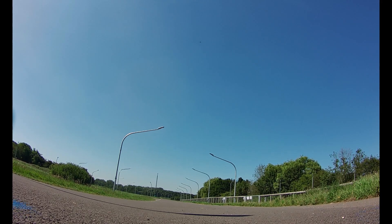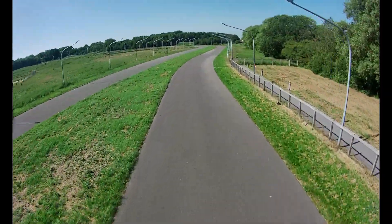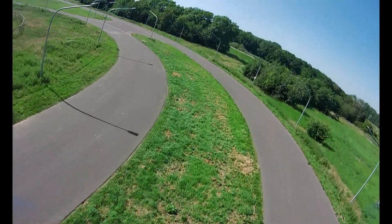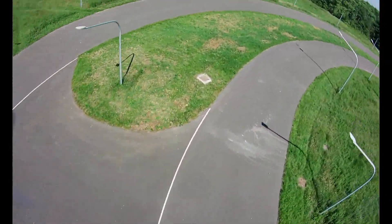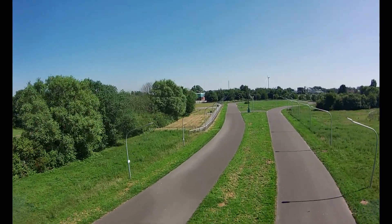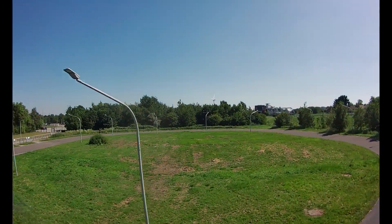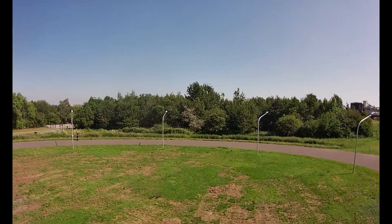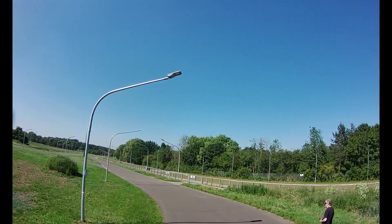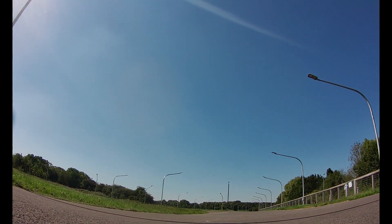For testing, I took the folding props off — they just didn't have the pitch to give the motors a proper blast. What I like to do with new motors is take off, give them a quick blast, then land and touch the motors to check they haven't got hot, in case notch filtering is off. Then take off again. We'll do a jump cut past that.